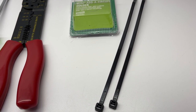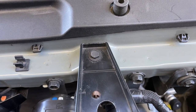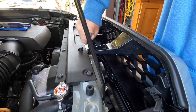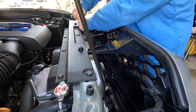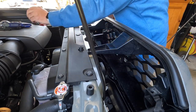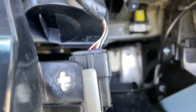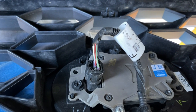Let's go out and get this grille installed. Removing your grille is easy — just two plastic clips and two 10mm bolts hold on the grille. Then remove the two wire clips holding the TSS sensor wire if equipped. I opted to not unplug the TSS sensor, as I've read that that can lead to connectivity issues.